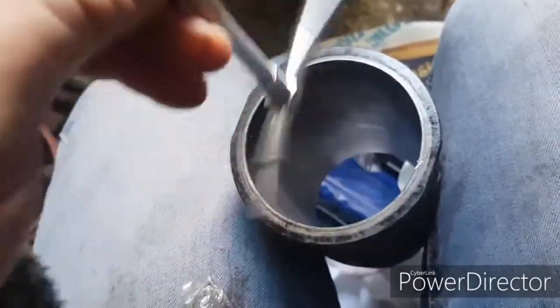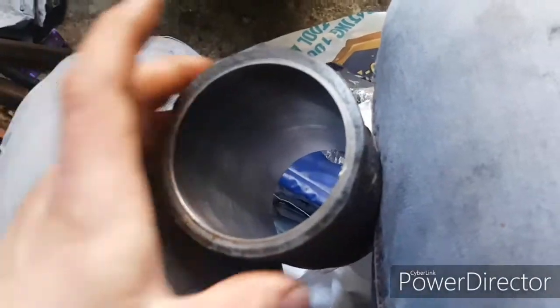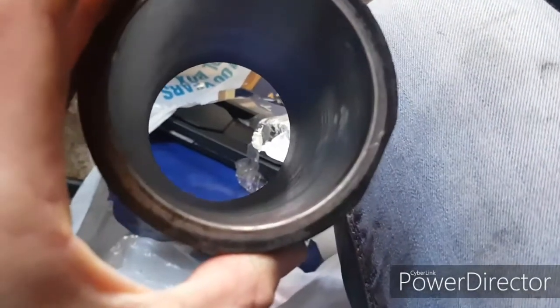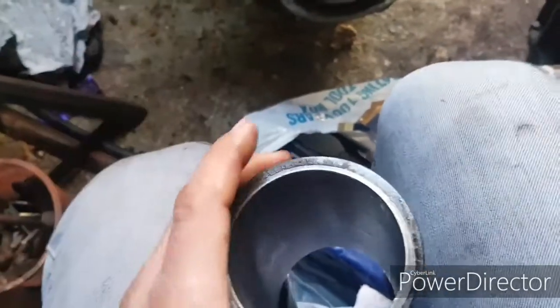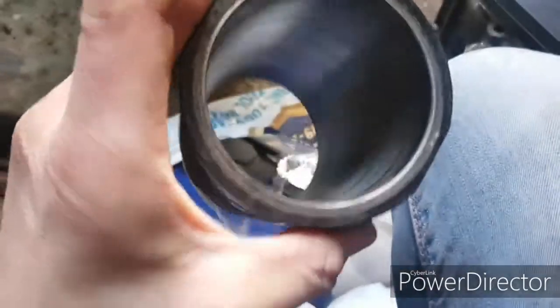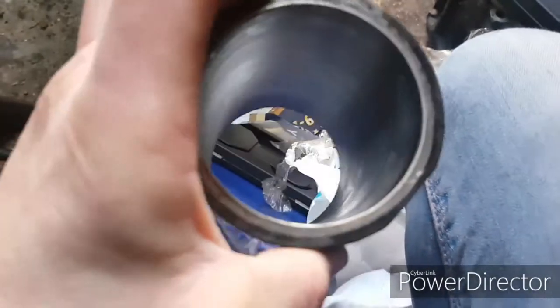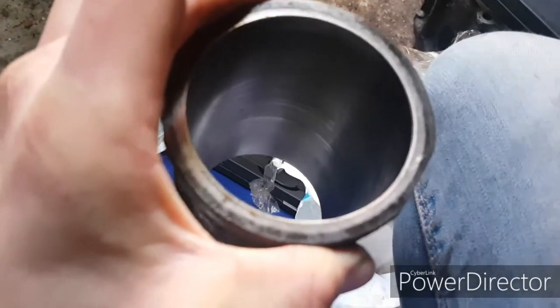So we take measurements with this, at all angles we can, all straight angles, side to side like that, all the way down, and then we find where it's worn and where it hasn't. You're looking for nice equal wear all the way down, because if you've got an area that's wider than the rest, that's going to allow the piston to wobble, because it's not going to be as tight and it won't have the guidance, if that makes sense. What I've found is that at the top of the stroke it starts at about 0.05 mil, which is absolutely brilliant really, but when you get to the bottom end of the stroke, we go out to as far as about 0.33 of a mil.